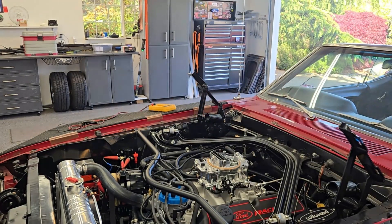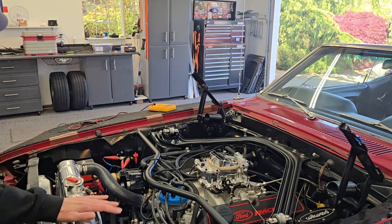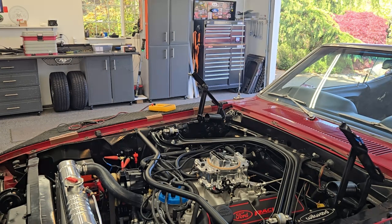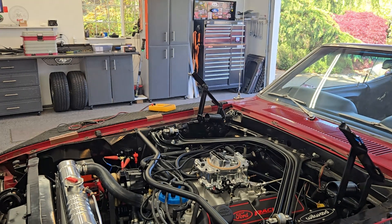Is that a magnet on your oil filter? Yeah. So far we had one little leak at the carburetor. The thermostat housing has a seepage leak, but it doesn't seem to be leaking now, which is odd. I'll have to change that thermostat gasket later. 393 stroker with a Comp Cam 364 hydraulic roller. Alternator is charging — it's a Power Master.